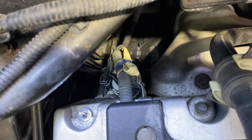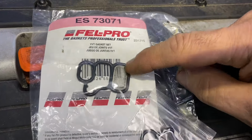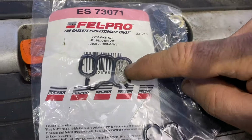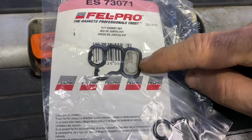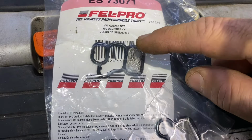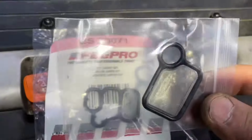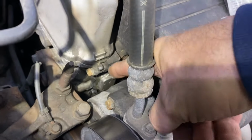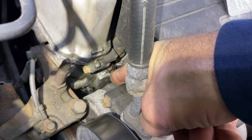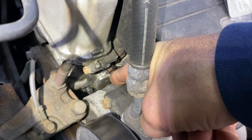If your leak is from the spool valve assembly itself, this is very common for this gasket to go bad. When you get a lot of miles in the car, it gets very brittle. It just dries up and cracks. And there's also a screen in there that filters out any junk from getting into the valve. So that could be plugged up. And there's also another screen, looks like this. That is right in the front under that little cover right over there. That's also common too, if you're having VTEC problems, that screen gets plugged up too.